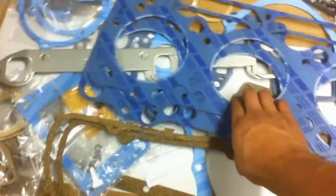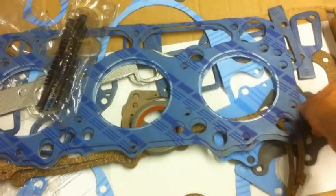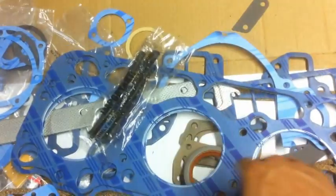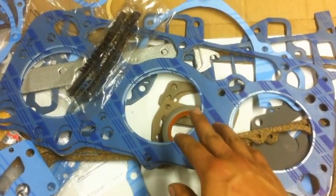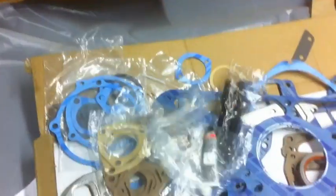Yeah, there's a ton of gaskets for this motor. Head gaskets, exhaust gaskets. The rear mains are the old rope style, which sucks, but oh well. Oil pan gasket, the oil filter adapter gasket. Big timing cover, the water pump housing, timing cover gasket, a bunch more exhaust gaskets and stuff, all that glorious stuff. And as if this 2-barrel is gonna do it all.